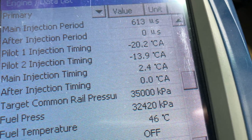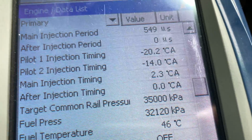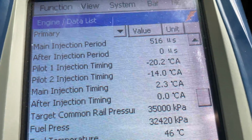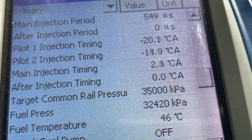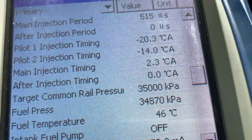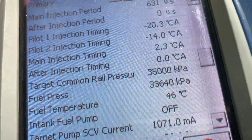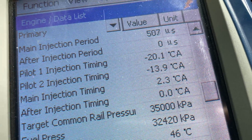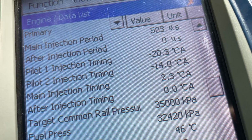You can do it earlier if you're fussy. You can leave it longer if you like. But we're just giving a general guide. It's not like food. We don't have to give a date. I say 7 years, 170 is the ballpark for all the 1KDs. Probably all common rail diesel vehicles probably would be a good guide. But anyway, some different injectors, some newer ones, some last longer, some don't last that long.